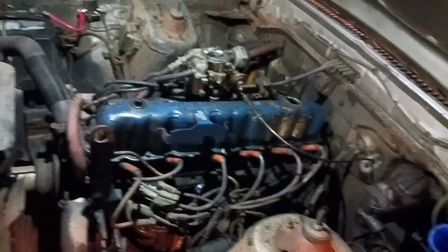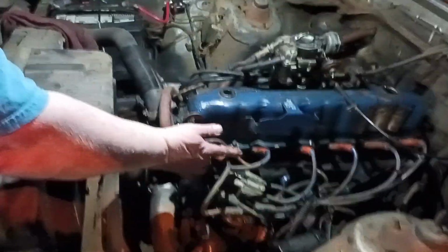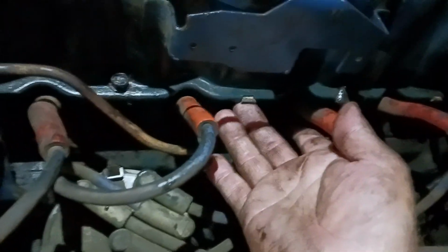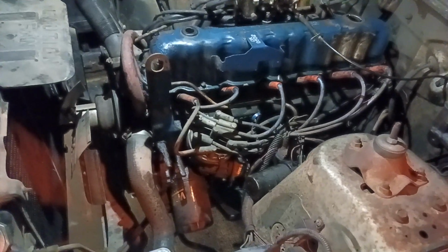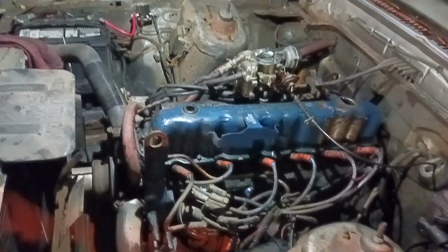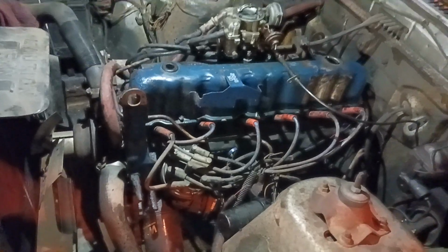I'm going to say probably 13 foot-pounds. You don't want it where your gasket is squashed out, because then that's going to leak like a sieve. There's a good reference of that little tab we were talking about earlier, that little thing right there. And check them after a couple of days, because the heat will move them. Just go back. They don't have any Loctite on them. You kind of do want Loctite, but kind of don't. That's up to you.